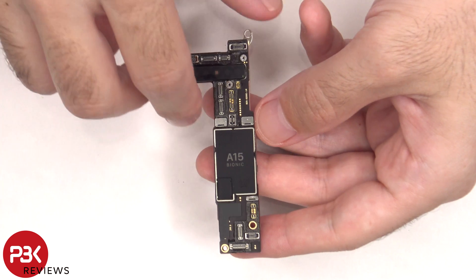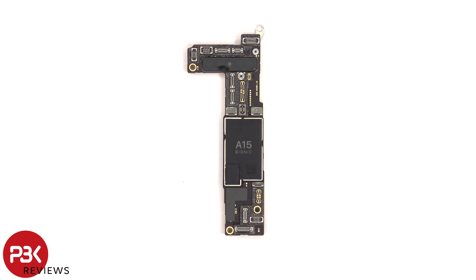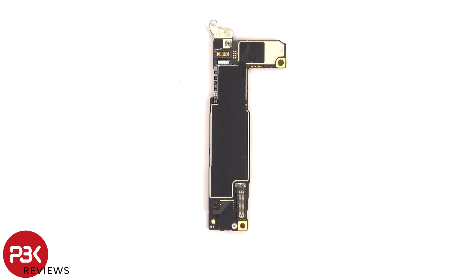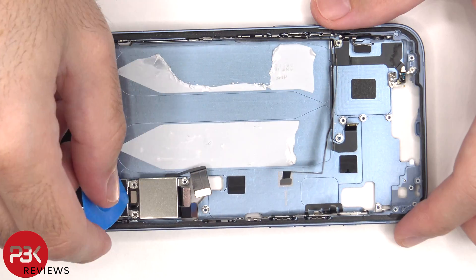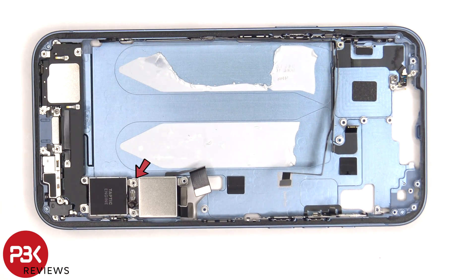The main board is a sandwiched-style board. On this side we can see a 5G millimeter wave antenna, some rubber gaskets around the connectors, and graphite film over the shield to help transfer heat. On the other side there's more rubber gaskets as well as graphite film on the shields. Now there are four more Phillips screws which need to be removed. And there's another standoff screw.